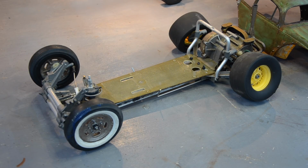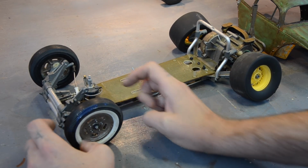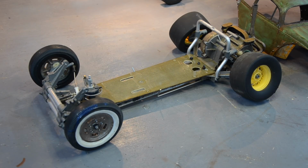The wheels were the ones that Awesome Designs made for me for the gasser originally. And they're made to accept the bearings and fit on a spindle. They are just a hair shallow for these spindles. And that one's tight, but I need to throw a washer in there and shim that out a little bit, one way or the other. But I'm not dead set on using those yet.